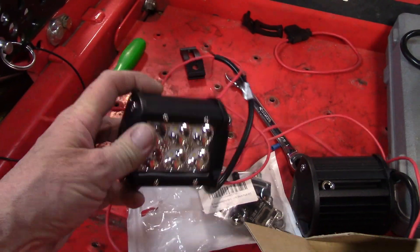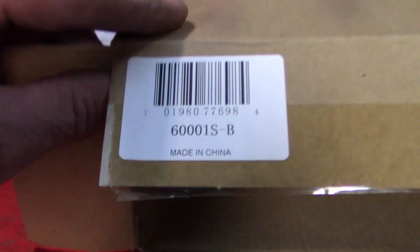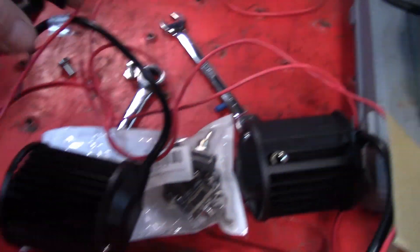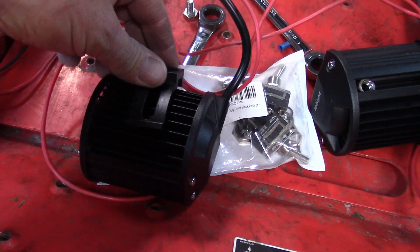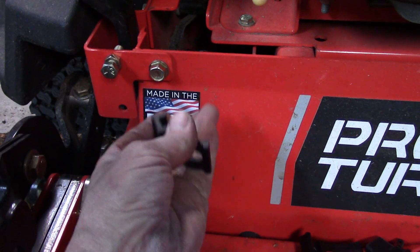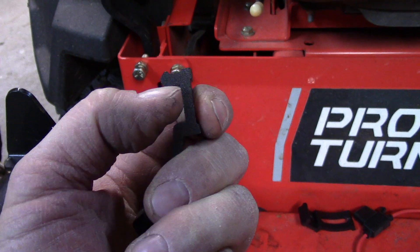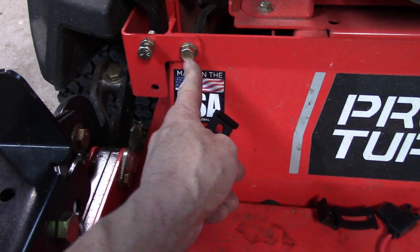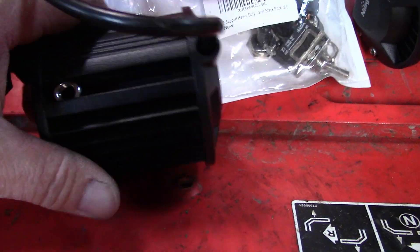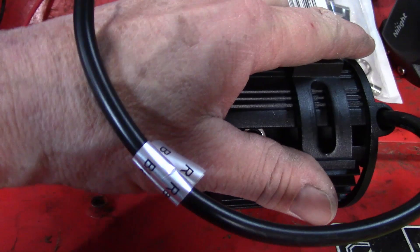Okay, this is what I have — Nylite lights. Everything's made in China, but they seem to be working out pretty good. There's the part number there. They come with these curved brackets so you can adjust them wherever you want. There's already a bolt here, so I'm just going to unscrew that bolt and mount this on here. But I am going to have to grind or cut this end off because the bolt's not going to fit into this here. It's going to be a real nightmare to get the bolt in once this is bolted up, because you have to go through the bracket — there's a trap nut in there — and then put the bolt in.